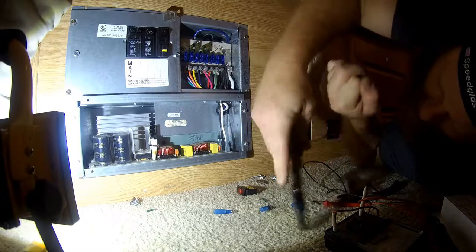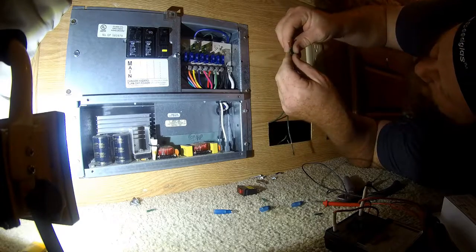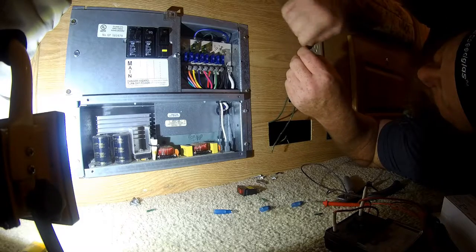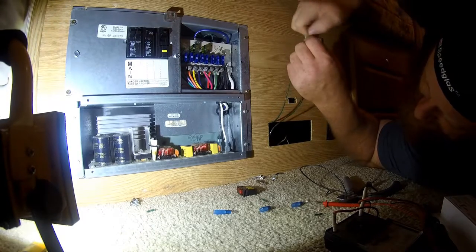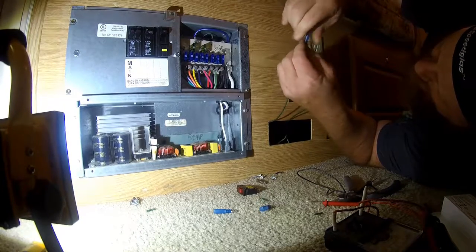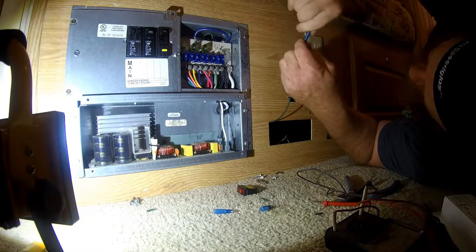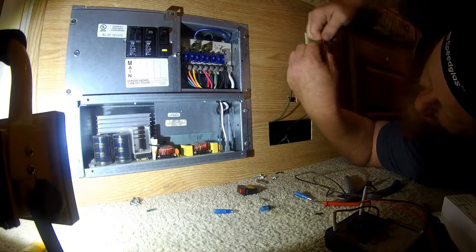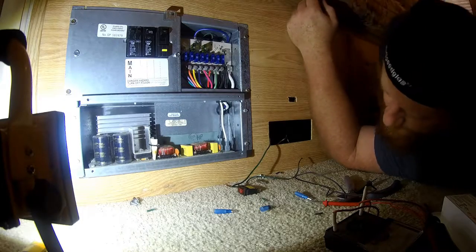Thing is, it's color coded. You don't want to run all of the same colored wire, like red hot, red ground, all that good stuff, that causes confusion. And later on down the road, even when it's you doing the work at different points, because you slept since then, you went to your daughter's wedding or whatever it was, you did different things. So, had to get different terminals. It's not big enough. Gonna have to pump. Do you have some butt connectors? I do. I've got all sorts of connectors.